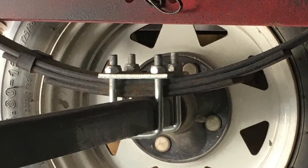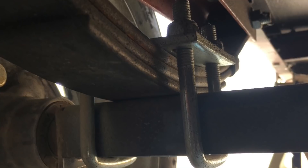The axles on this little trailer weren't sufficient, so I had a 3,500 pound axle custom-made to fit on a 5x5 bolt pattern to run stock 32-inch Jeep Wrangler wheels and tires.